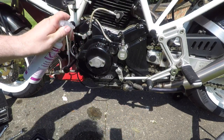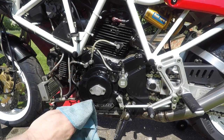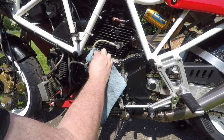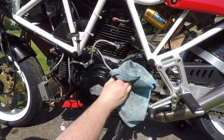Final check — I like to spray a little bit of ACF 50 afterwards. It stops any corrosion and while you're in there, gives you a chance to have a bit of a wipe up, get any spilled brake fluid out of the way before that does any damage. Also just check for any leaks while you're in there.